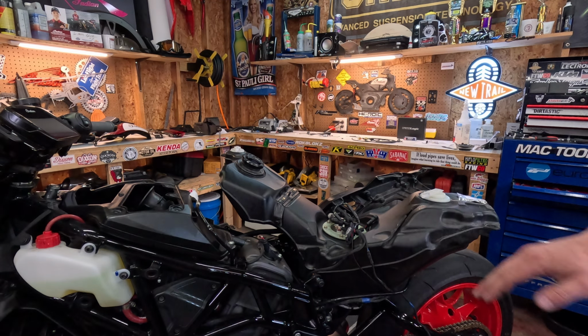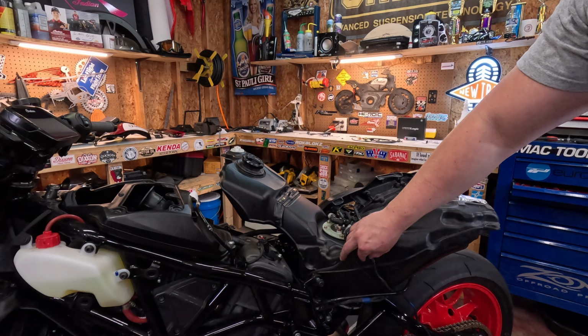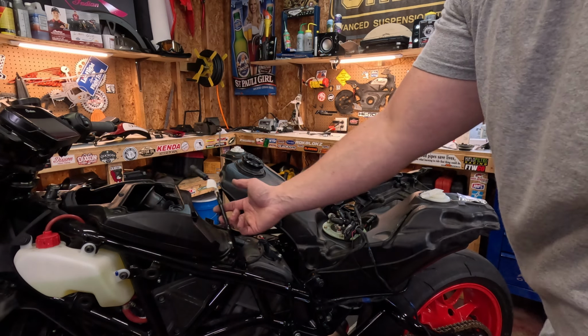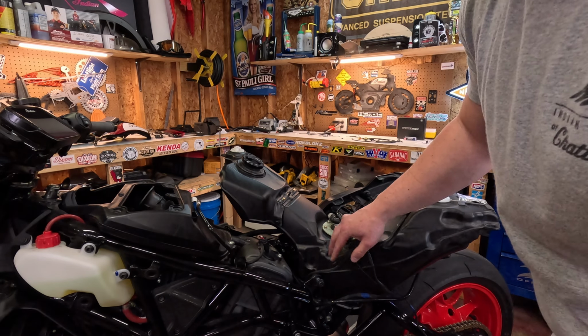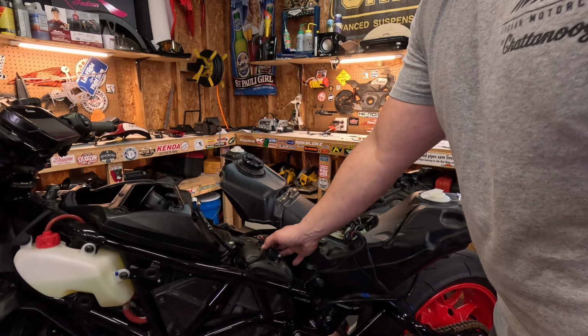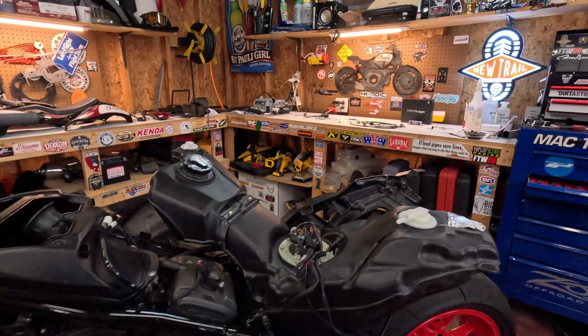So as you can see, I just disconnected some connectors. Obviously, a bunch of this stuff is all my plate eliminator stuff. You want to disconnect your front vent hose and then your aft vent hose and just let them sit. But we were able to just pick it up and shift it over, and now we have access to our rear coil. That's easy enough. I'll come over here and show you.